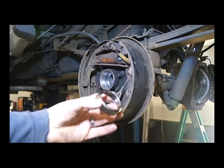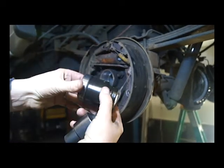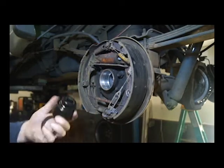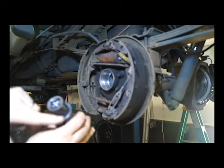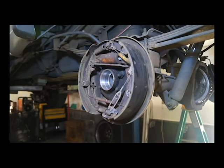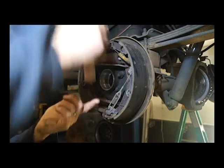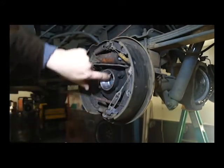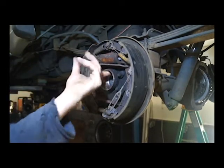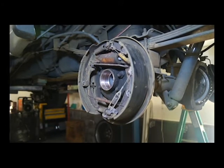What I did is I took this bearing, found a socket — it has to be a 38mm — that fit right on, just a little bit of slack in there. It downsizes it so I can hit it with a hammer. I already did the other side, but I'll show you how this works. Now, I'm applying lube on the inside with this engine assembly grease. Really good stuff. I call it raspberry jelly. I don't know if it tastes like raspberry, but it sure looks good. This stuff is super slippery. I haven't got my bearing yet, but I'm going to run and do that and I'll be right back.